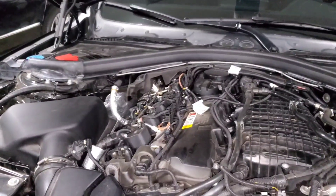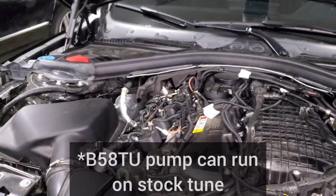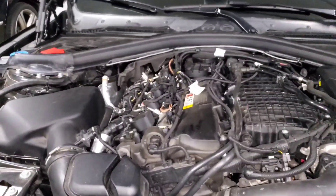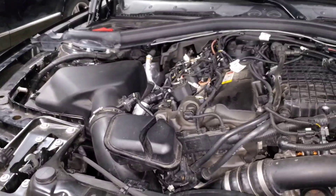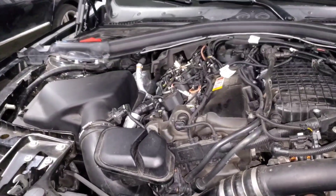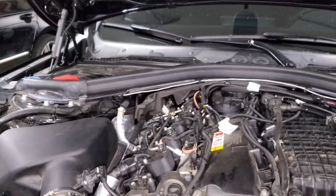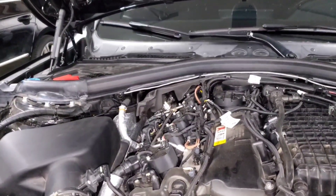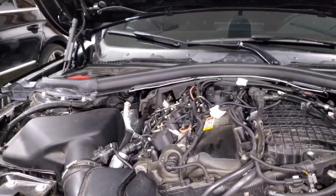Upgrading the fuel pump is a great option if you want to stay tune-only — you can basically plug it in, modify a couple settings in the tune, and run the fuel pump without issues. The only downside is you need to build your car around your high pressure fuel pump limits. The stock pump can flow for about 450 wheel horsepower on the stock turbo — that's a DynoJet figure — and about 500 wheel on a bigger turbo. Even on the TU pump with E30 or E50, you can make around 500 wheel on the stock turbo, and with a bigger turbo probably close to 600 wheel. So that pump is good for about 600 wheel horsepower.